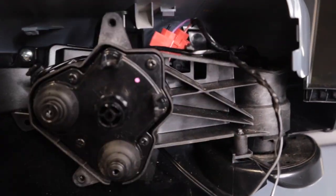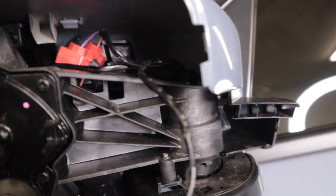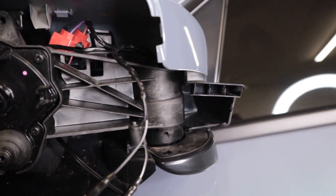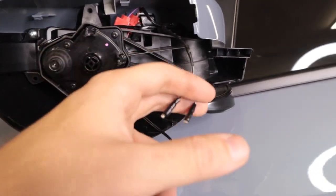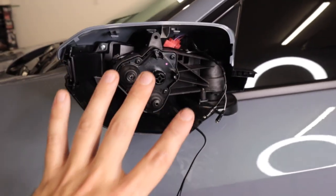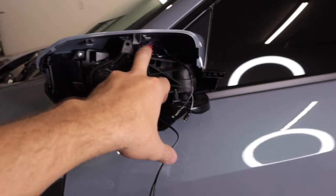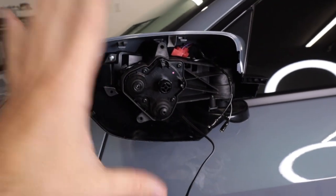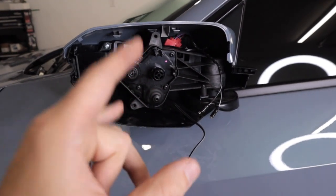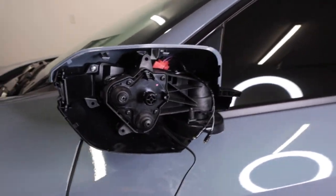Just to give you guys a little visual — like I mentioned, solid black goes to the purple. Then the off-pink, peach color goes to the black striped. As you can see, we have them tapped in. I went ahead and tested everything — everything works good. This is for the new Sumo Performance glass turn signals, and then this is for the defroster. Once I get the driver's side done, all patched up — but I wanted to show you guys, I went ahead and buttoned everything up and did that one off camera. Everything's wired up and in place. Everything works. So go ahead and button this back up and then we will go ahead and show you all how the turn signal looks. And again, with the smoked turn signal, we'll turn the lights off and check everything out. And that's a wrap.